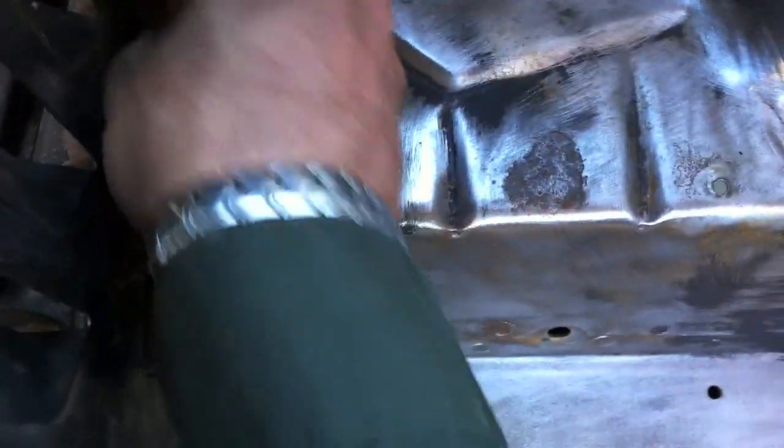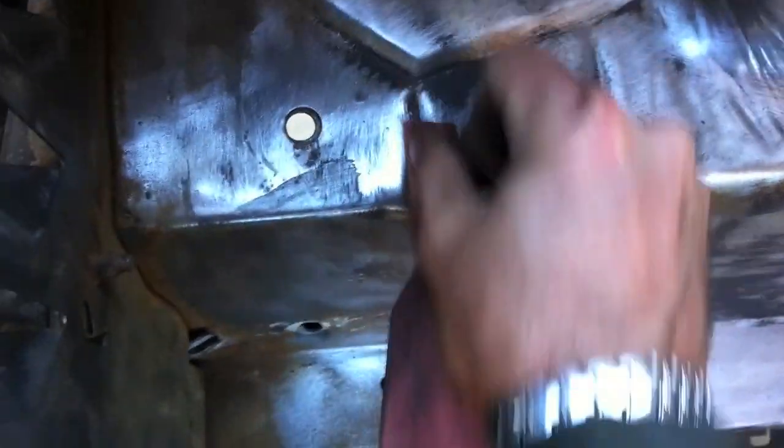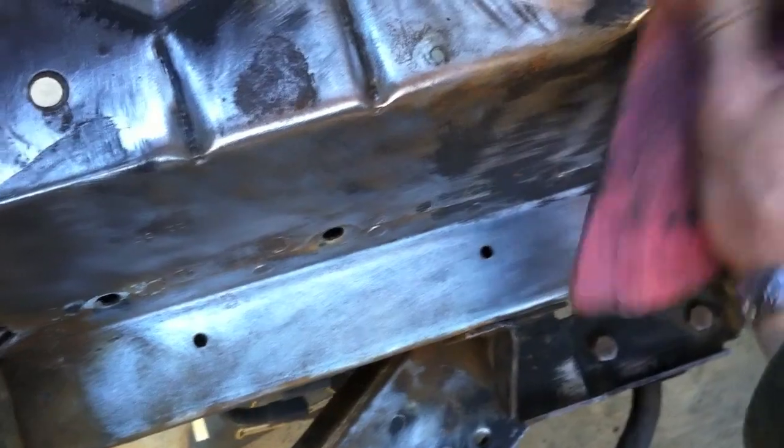My future marketing manager! Basically sanding like this with sandpaper, getting into every little nick and cranny to make sure it's nice and smooth before the paint. Been doing that on this side and going across the top — not taking the fenders off, so I'm going to have to mask it off and keep going all the way around. This area is pretty much done and we are really, really close to primer — I'm going to black primer.